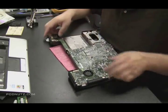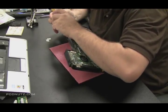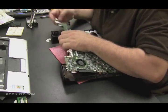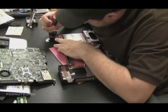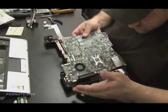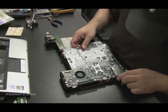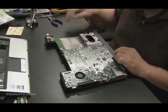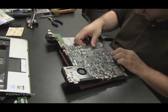I'm going to size it up again and see if it fits snugly this time. Look at the side, make sure the hole of the power jack lines up with the hole on the outside bottom case. We're going to cut a little bit more plastic here to make room for that wire. Using this method with the wire, the power jack is going to last a lot longer because you've got that flexibility. But the only thing you've got to worry about is now that you created that wire and put it into the circuit board, is it going to stick out? Is it going to make a connection? Is it going to short out a part of the motherboard? If it does, you have to make sure you secure it with electrical tape and cover up the connections you created, and also create more space, which is what I did with the pliers there.